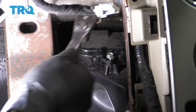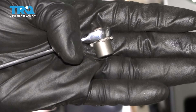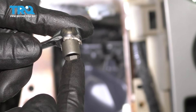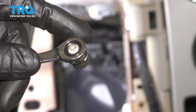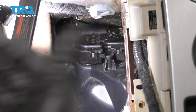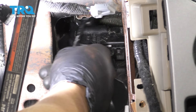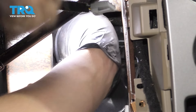Now you can take an 8mm socket or wrench and remove this screw right here. Grab this one — there's one more on the back side right there. Unfortunately, you will need somewhat of a special tool to get to that rear bolt. I made this from a quarter-inch impact driver socket — it's an 8mm, or five-sixteenths, but it's the same size — and this is being driven by a quarter-inch ratcheting wrench. That is the only way to get back there and actually remove that screw. You can also reach in through the glove box if you pull the glove box down, but the problem is the distance between this actuator and the bottom of this dash support. With this tool, I can go in like this, set it right down on that screw, and unthread it. At this point, I can spin it by hand.